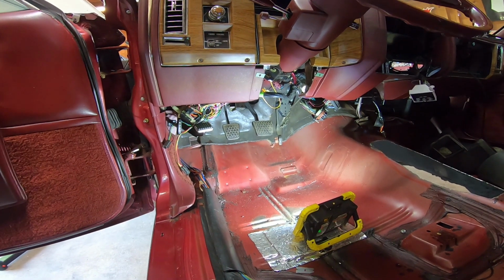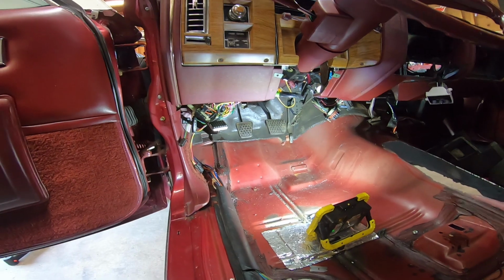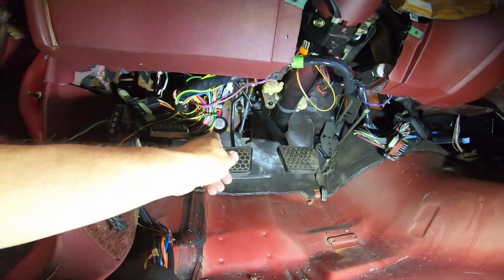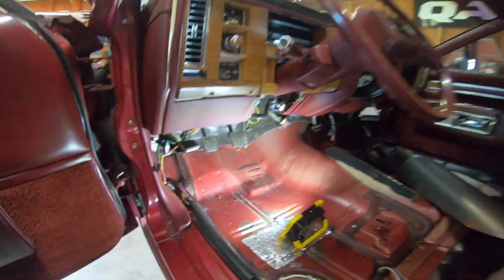And it's got our 6-speed Monte G-body hydraulic conversion kit mounted on the front. So the G-body stuff bolts onto the firewall. I did have to put our adjustable master cylinder on it to get a little bit better clutch rod angle. You can see how all that works there. Again, I've got another video kind of going over some of that stuff about the clutch.